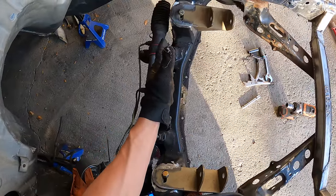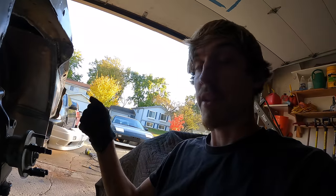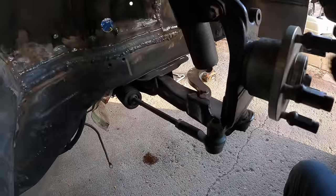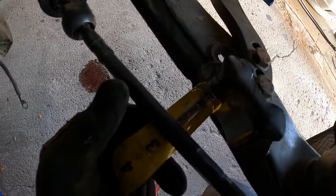Relocating the rack moves the entire rack about an inch or so forward by cutting the subframe so you can slide everything forward. Why is that important? When you're drifting, it creates steering bind - at full lock or even mid-drift, the steering wheel can feel stuck because suspension components are not at a cooperative angle. I figured it'd be a good idea to take measurements before and after so we can really compare the difference. I'll measure at full lock, perpendicular with the inner tie rod, from a marked line on the control arm.